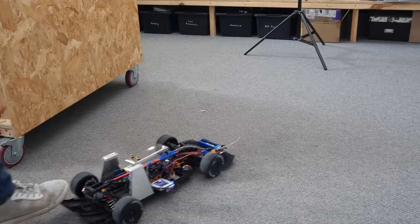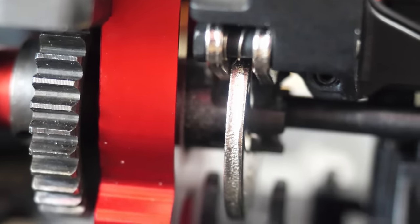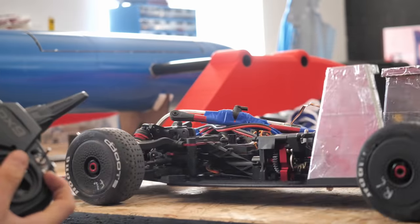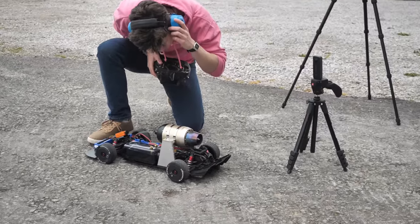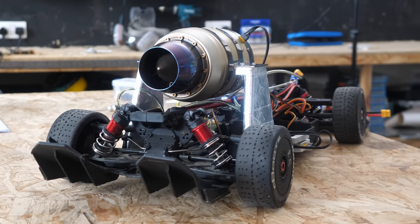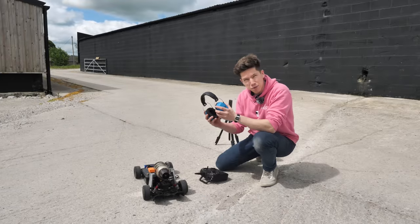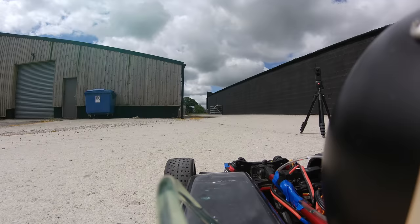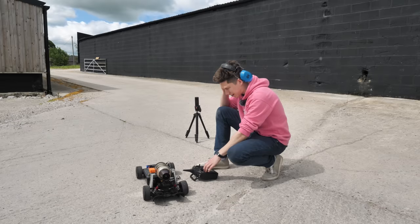It seemed to work quite well. I only linked up the prop shaft to the rear wheels, but later I could decide to link up the front wheels too, as this RC car is actually four-wheel drive, so I'd have to figure out what the best compromise was. I also set up a switch on my transmitter to work like a handbrake so that I could fully engage the servo while the engine was ramping up to idle. Now I had a way of preventing the car from accelerating away. Time for test number two — let's get this thing fired up. I've got my ear protection — very important. Handbrake engaged. Let's turn this onboard camera on. I guess we'll go for ignition, and I'm going to get ready to shut it down in case the brakes can't hold it.